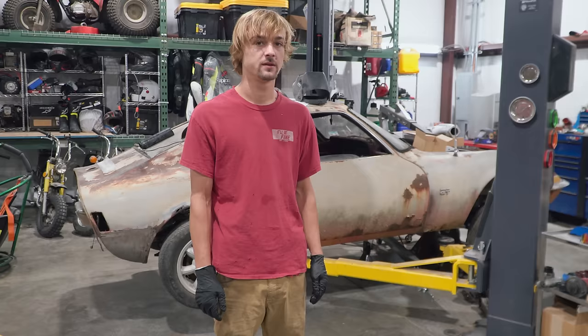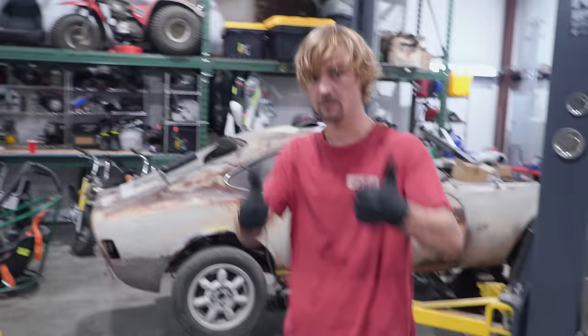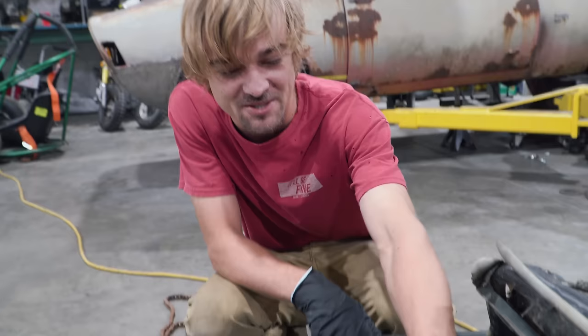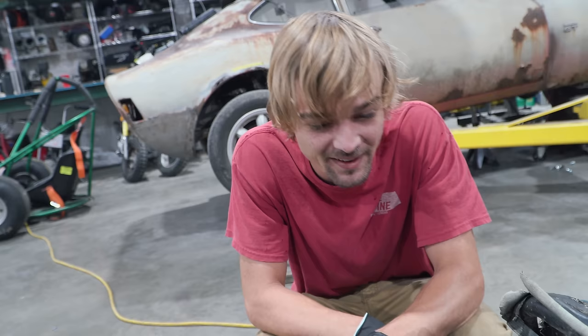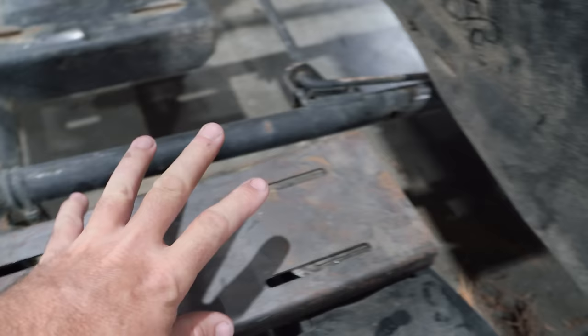So we already started working on this cart. Yep, the engine flipped out on it. But that's okay. So the yellow mark right there and the yellow mark right there, Charles is gonna drill those out for the engine plate. This is our Go Power Sports engine plate that we're gonna weld into place, because that's the other side of the engine plate. It may look like there's two engines going in this, but no, it's just one. Although, if you think about it, we could. Four engines. Four cylinders. So I'm going to be working on a cross piece right here so we can weld in this plate solid.